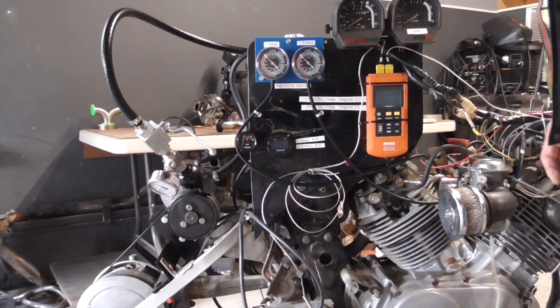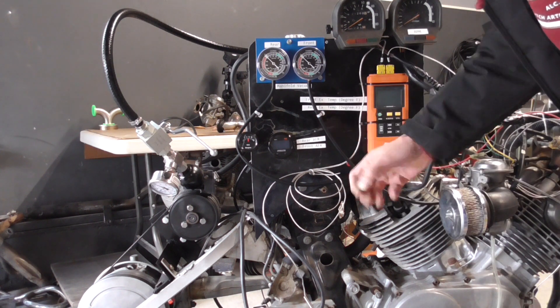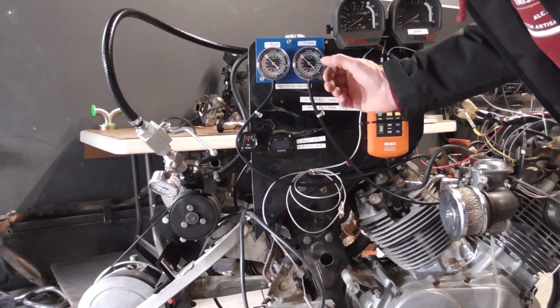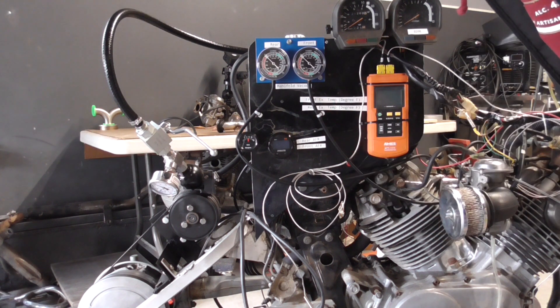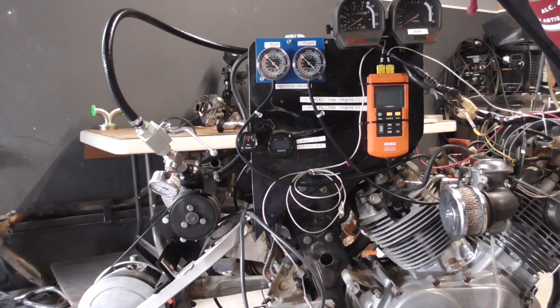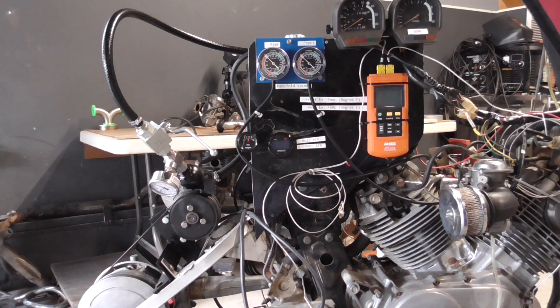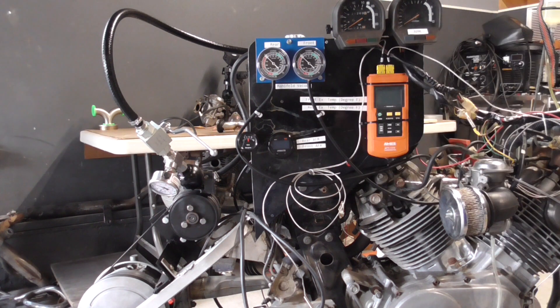You can see that front cylinder was a little bit leaner than the rear. I've got to adjust the carburetor — I'm a little bit rich when I throttle up right now, but that's a good thing because the other single carb intakes were actually leaning out when I throttled up. So this one's doing a whole lot better. We might run a little bit lean at idle, but when you throttle up and you're running down the road, you'll be fine. But it's still weird that that front cylinder wants to go lean. So I'm going to go over to the other side and show how we're going to adjust this timing so that maybe we can make the front cylinder lead and change that front being too lean.